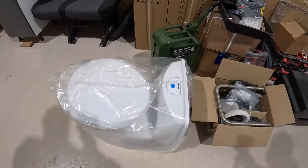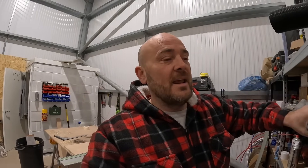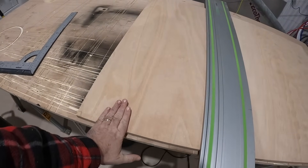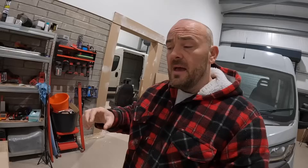The toilet is actually going in the centre of this, coming on a slide-out. He's bought a cassette toilet — one of the ones that has to be plumbed and have an electric supply for the pump. We're going to build a box for it. I've bought these heavy-duty runners — these can take 220 kilograms, that's nearly a quarter of a ton. I'm going to do the base out of 18mm ply because it's the strongest we've got. I'll cut out the base, make a box, do some runners, and then do another case in the garage so the runners can be secured and that box can attach to it and slide in and out. Today's job: get the design made, get it built, get it tested, and all being well I can then cut the hole out of the front of the bulkhead and do the door for it.